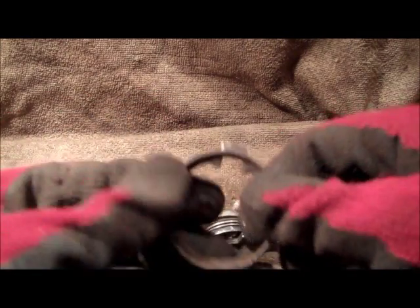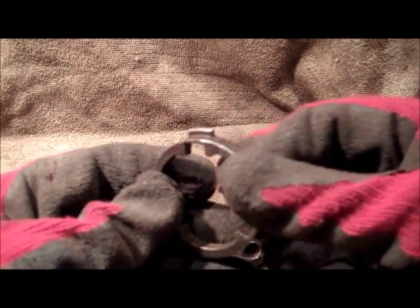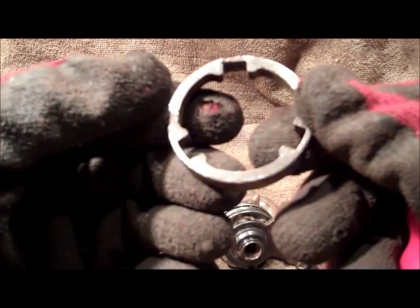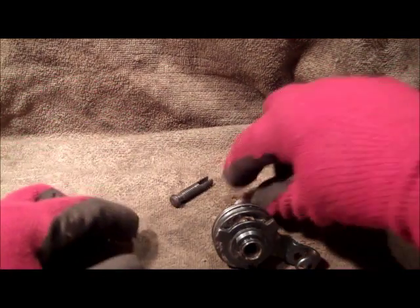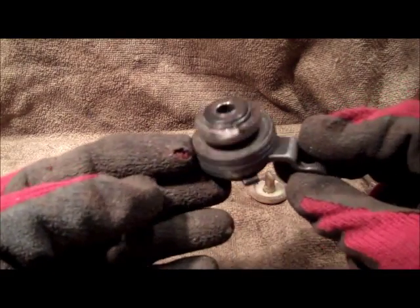Checking the parts over - the thrust plate first. If you saw my last video you would have seen that this lug that sits inside the caliper body had been ground away. You can see how on this one it's much larger, and it actually looks in better condition than I thought. It's got some chipping on the inside, but other than that it seems in reasonable good condition - a little bit pitted and rusted, but looks like it should be okay. The screw thread, adjustment thread, looks to be okay as well. The little plastic ratchet adjuster - all the teeth look good, no breakage, no cracking. That looks good. And the last thing to look at is the adjustment arm itself.